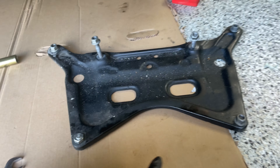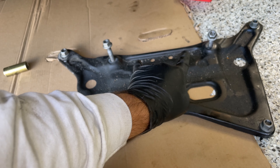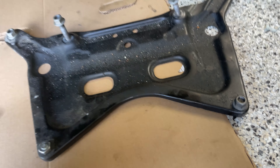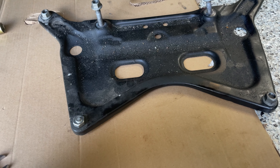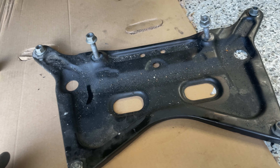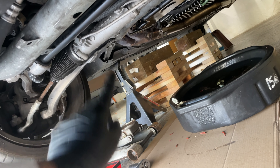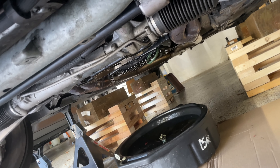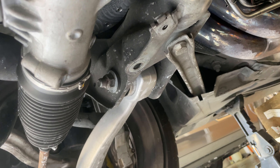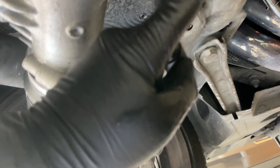The brace is finally out — it doesn't take long. You really just need an 18mm socket for the bottom and an 18mm wrench for the top. Keep in mind this is the orientation: this is the front, that is the rear. The two long bolts go in the inner back ones, and this goes through the power steering rack into the subframe — keep that in mind and keep it oriented properly. That's how it sits in the car. Clearly it's pretty bad — going to clean that up. Next we're going to take off that bar right there — it's smaller than 18mm, so maybe a 16. Let's figure it out.